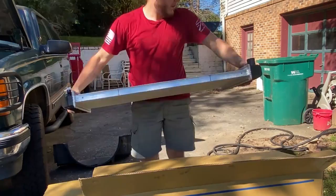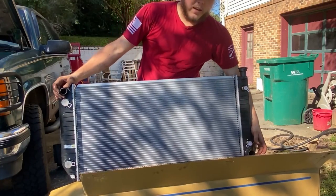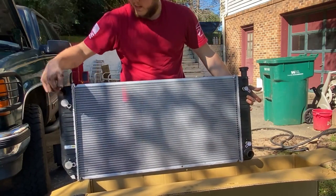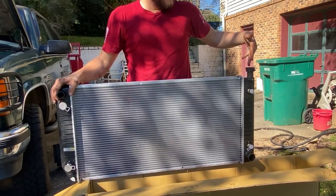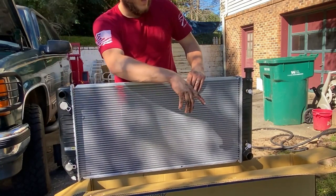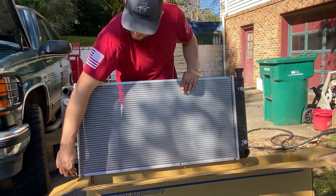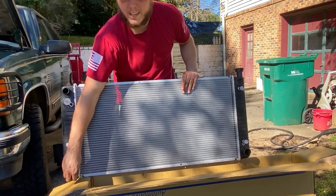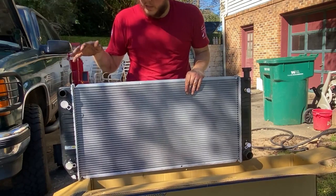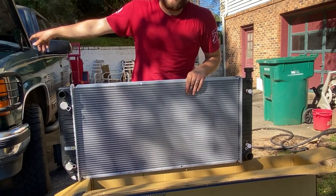Check orientation on all of these items - make sure your fill and exit points are in the right spot. Some vehicles, because of space limitations, can have them on different sides - it's a whole thing. This could not even be on the radiator; it could be at a different point in the cooling system. Just make sure everything fits. These actually have plugs in them that we'll take out. This is where our trans cooler lines are gonna go, and this is our stopcock so next time we need to drain it we can come out of here. We're gonna slide this back in exactly how it came out.